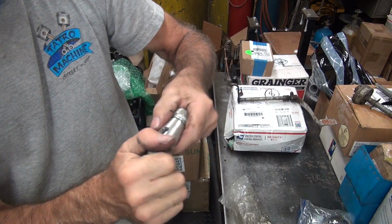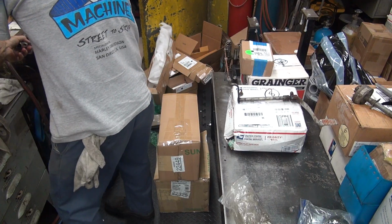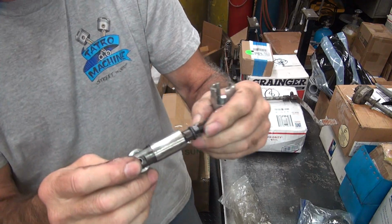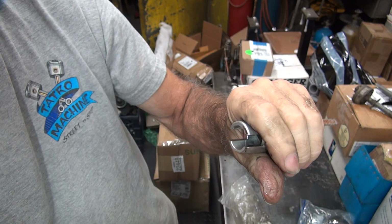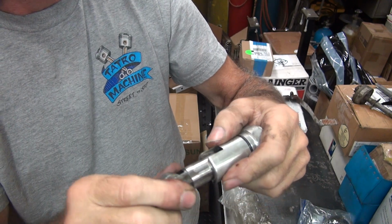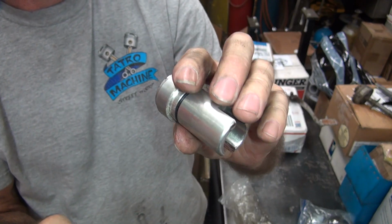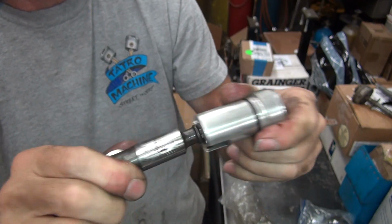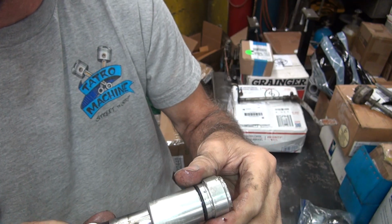That is definitely tight. Yeah, I can't pull them out like that. Yep, same thing. Everything looks brand new, but it just doesn't fit. See right there is the okay fit, which is probably how it started, but they locked up because they didn't have things right. They were too tight. If they're too tight, they start sticking. So these definitely are sticking.